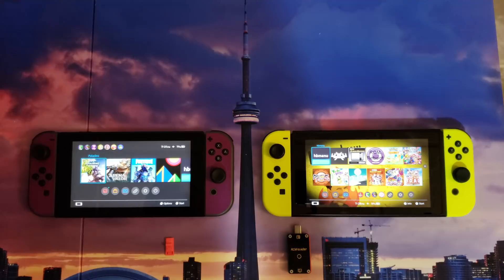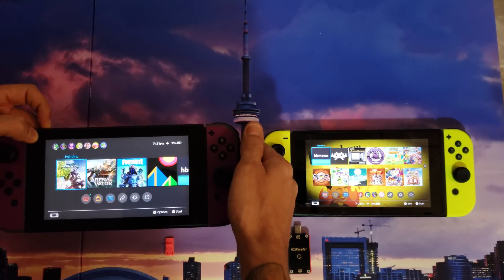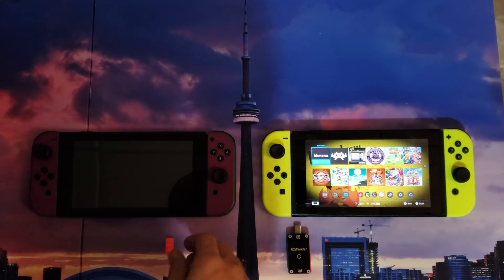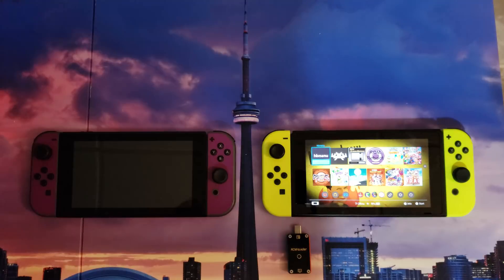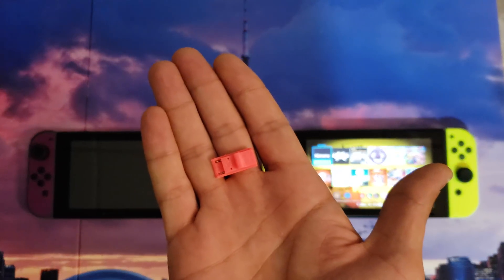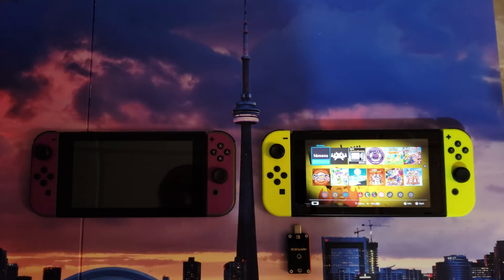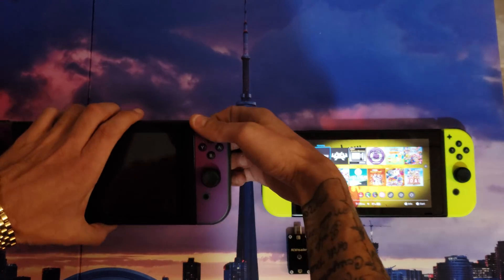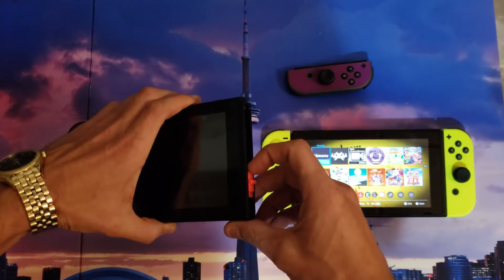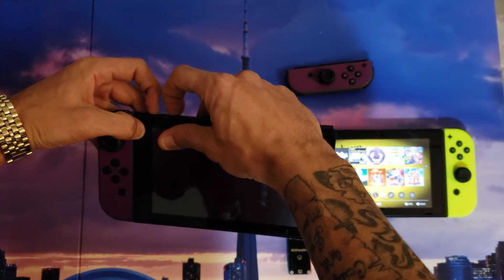Now I'm going to show you real quickly. I'm going to take my Nintendo Switch here on the left and power it off. Now if you don't have Auto RCM, you're going to need to get into RCM mode on your Nintendo Switch. I have a little jig right here — this one shorts out pins 1 and 10. You can also short out pins 10 and 9, that'll work too. Remove your right Joy-Con, slide your RCM jig all the way down into place, hold the volume up button and then the power button for about 3 seconds.